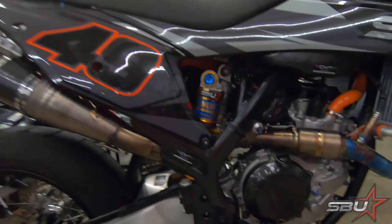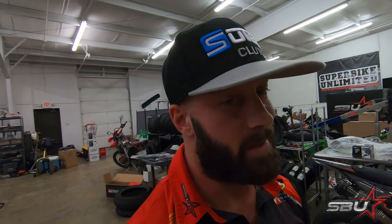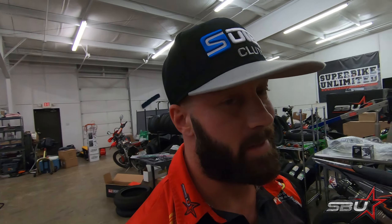It's a lot of work when you're chasing this kind of thing in a prototypical setup — we're constantly taking an expensive component and cutting and modifying it. But I'm pretty happy with the numbers we have on the motorcycle now in terms of swingarm angles and trail. We may still consider trying a lower offset in the triple clamp to see how it affects grip levels, but for now we'll just try it like this. Also, we finally machined off some of the stuff we didn't need on the MX bracket — you can see it's got a mirror finish now, top and bottom. That knocked off several grams. We're going to weigh this thing — it should be about as light as it's going to get with all the titanium installed.